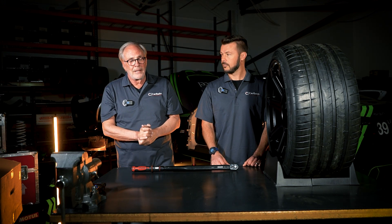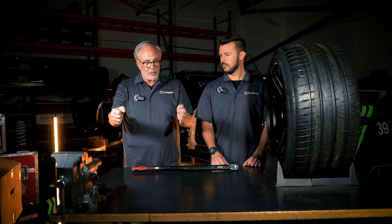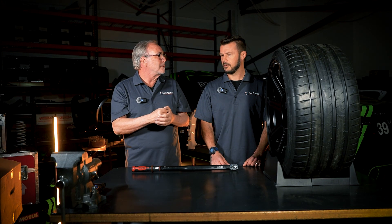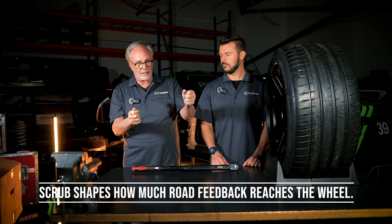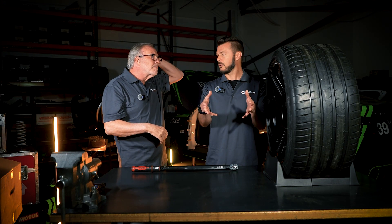The reason we have scrub is: if you have a distance between the tire and the suspension imaginary contact points and where they hit the ground, when you hit a rut or a change in road surface or anything, that leverage causes the tire to pull in your hands and move the steering wheel. It gives you a tactile sensation of what's going on with the road — you feel the ground through the steering wheel.